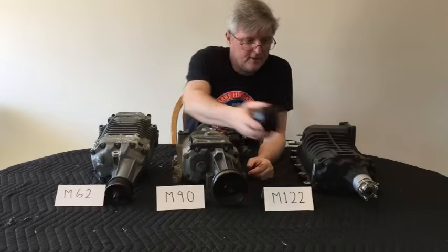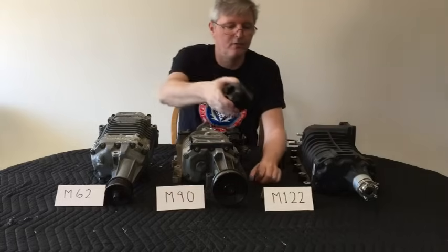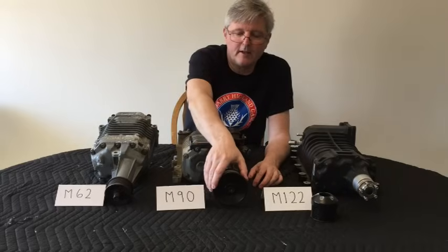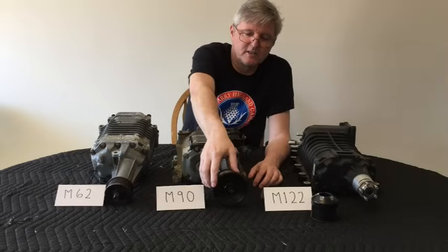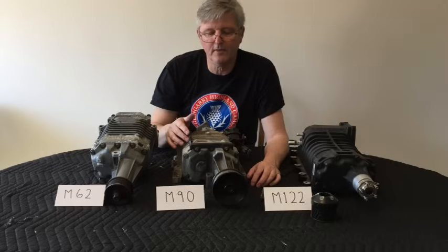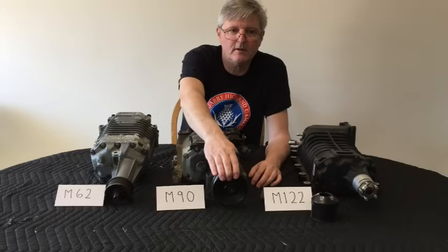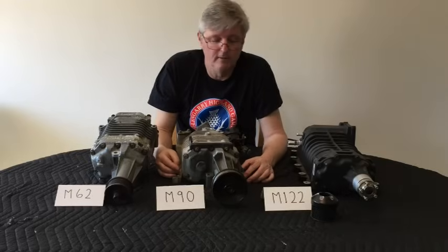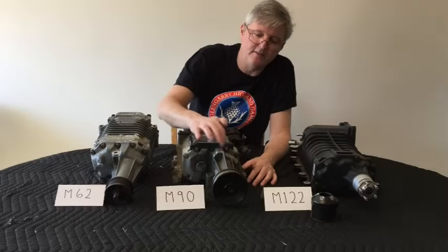Here is the pulley. The nice thing about the pulley on the M122 is that it's very easy to replace and size it up or down as needed. The M90 pulley was a pain — it's a press fit with no keyway. I went with the smallest pulley I could get on my Crown Vic in order to spin it as fast as possible. I had to replace it with a smaller one and it was a real nuisance to get off. They do sell a puller tool, but mine was on there so tight that I ended up mangling the tool. I ended up taking it to a friend with a press to pull the pulley off and put the new one on. You also have to dismantle the snout — there's no gasket, so it's easy to put back together.